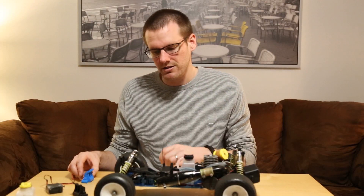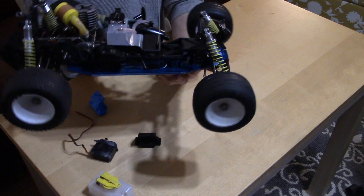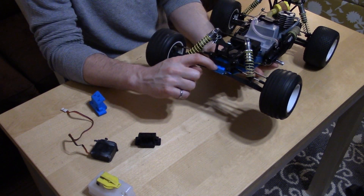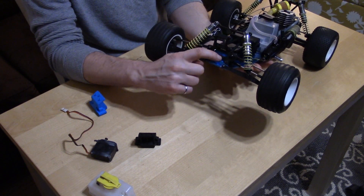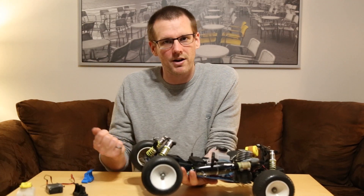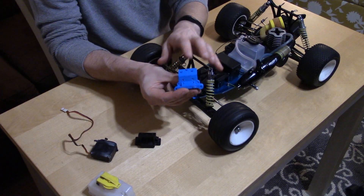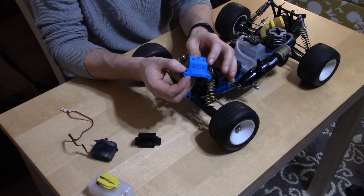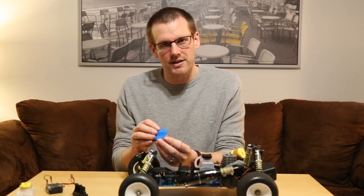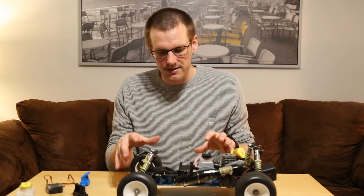I ended up getting that part completed and there's one installed in the vehicle right now — it fits quite well. Because of the damage the vehicle took before I received it, the aluminum piece was actually stretched and I had to cut it to act as a washer. So right now there's no structural strength gained from the aluminum piece — it's just there to make sure a front-end hit doesn't rip the part out. If there were a direct front impact right now, the part would definitely blow apart. That is one disadvantage of PLA — it's very strong under normal loads, but under a high impulse load it will break very easily.